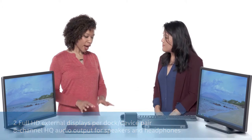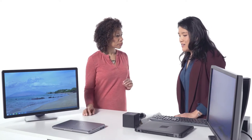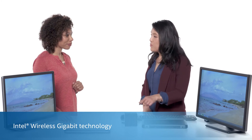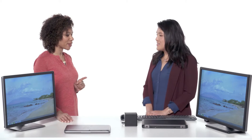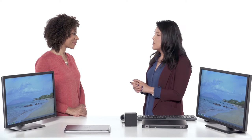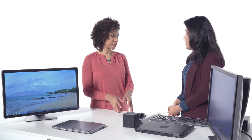How exactly does the wireless dock work — is it Bluetooth enabled? No, it's not. It uses Intel's WiGig technology, made possible by that Tri-Band Wireless card built into the device. WiGig technology is actually similar to Wi-Fi, only it's the third band. It doesn't transfer data over Wi-Fi channels or Bluetooth — it transfers over WiGig at a 60 gigahertz frequency band, with much faster data transfer speeds than Wi-Fi or Bluetooth. So it's faster and more secure.